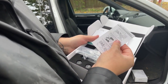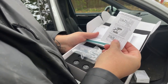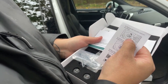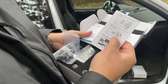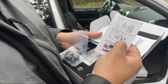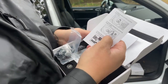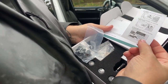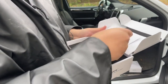I'll show you alongside: unscrew the valve cap, put the hex nut on, and the dust shield — screw the sensor in and tighten it up. It does provide a wrench that fits perfectly for this. You can spray with soapy water to check for leaks — if you see bubbles, it has a leak and you may have cross-threaded it. Then place the dust cover over top of the sensor. It's as easy as six steps.